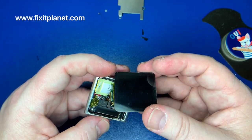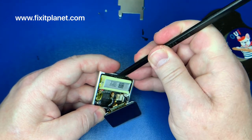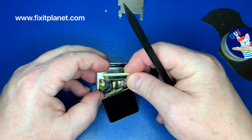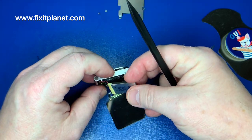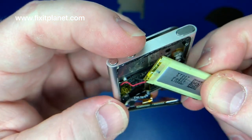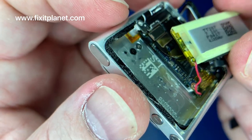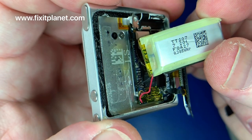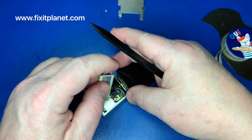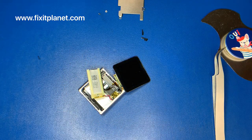We'll be cleaning both the housing and the display itself. We'll also be using a primer, which will give us some added strength to the bond. If you're still having problems, you could potentially use a few drops of a very tiny amount of super glue — the control gel type, like Loctite. That might actually help to hold the screen in place.